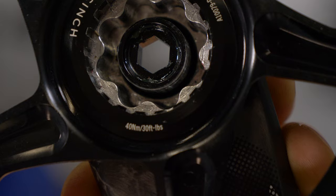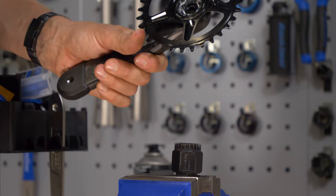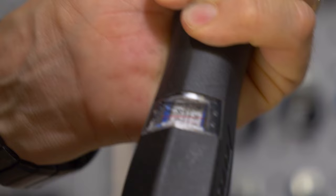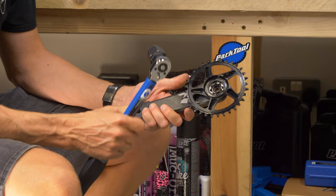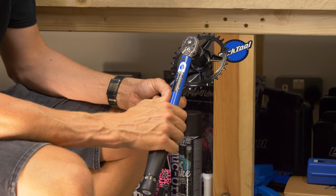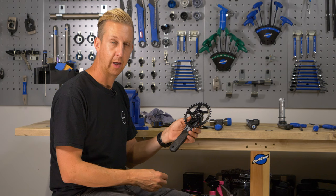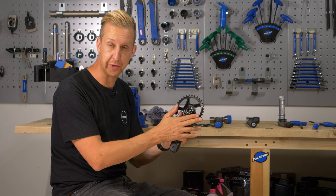On the back here, it does tell you that you should use 40 newton meters of torque to tighten this with a torque wrench. Now, some people don't have torque wrenches, so you're going to have to use common sense here, but that is very tight, so I would recommend tightening it securely. I'm actually going to use a torque wrench here just to demonstrate — it is a safety item, so it is recommended if you can. We're going to dial it into 40 newton meters. You would ideally have your crank arm in some soft, closed jaws, but I'm being very careful with this carbon crank. You'll know when you're at the correct torque setting because the torque wrench won't let you go any harder — it will click like this. We have our fresh chainring remounted back onto the Race Face crank, checked to 40 newton meters.